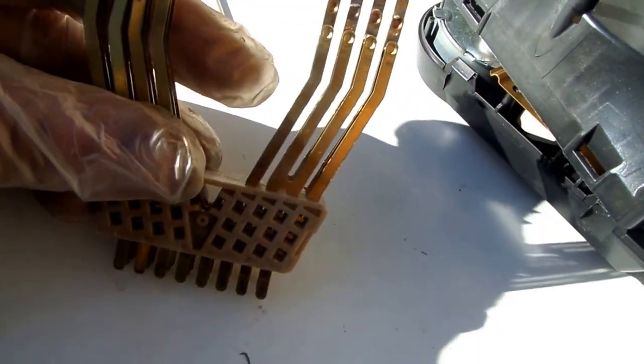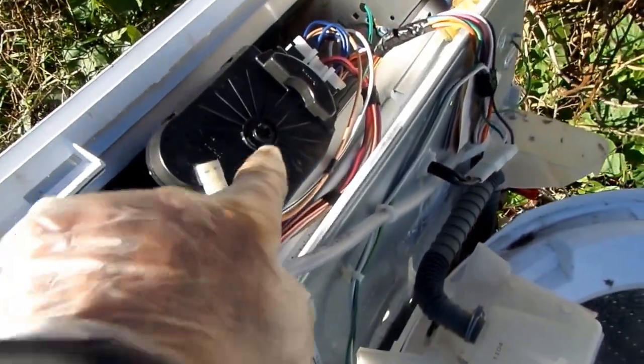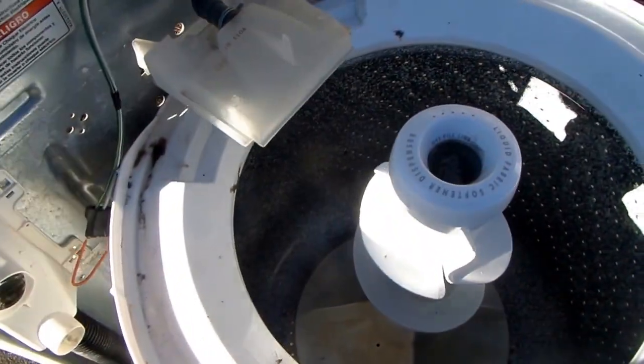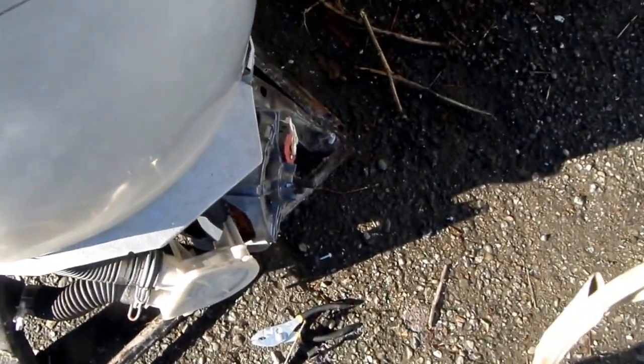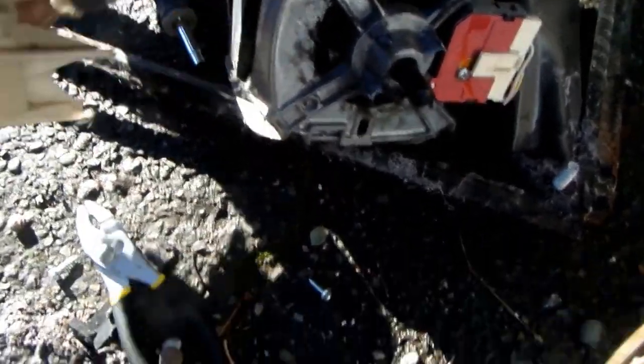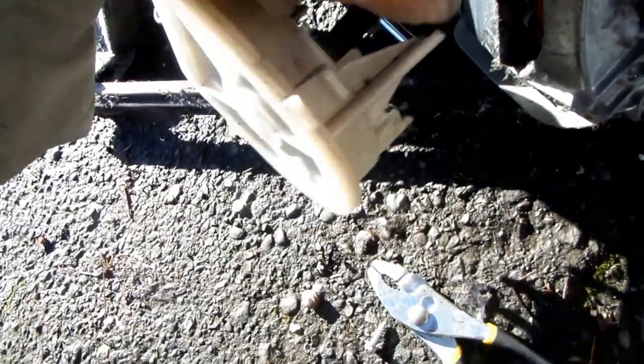The timer is back on — push the center piece in so it holds the knob tight. I still have the temporary lid switch bypass and motor removed to isolate the transmission. You don't typically have to do that, but I did it for this situation. You might also want to check the water pump: put the clip inside and turn it. If it's stiff, you need a new water pump or something is stuck inside.